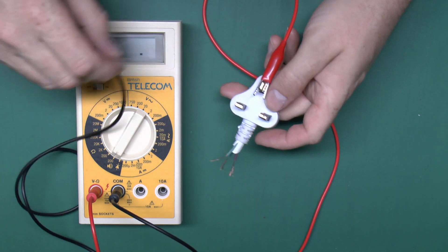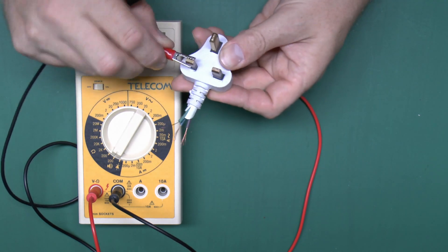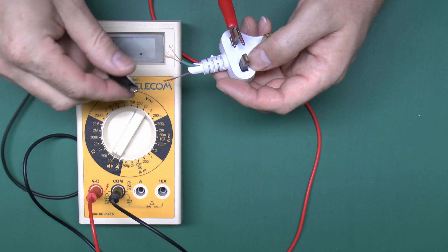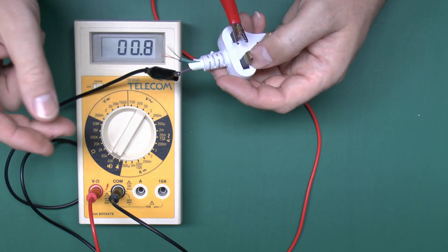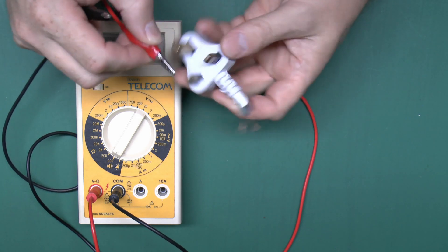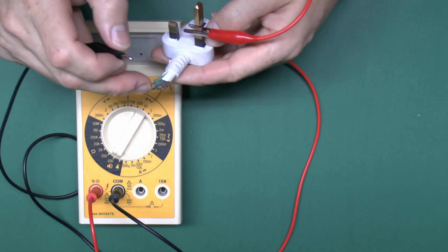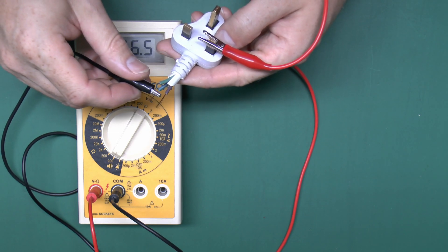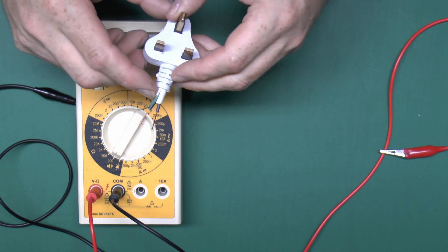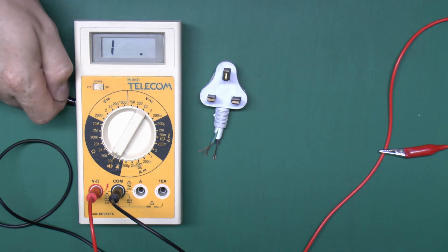While I've got this meter out, I thought I'd just check the other wires to see if they're connected to the correct pins. This pin here is the line, marked L — yes, that is the correct side, so it should be connected to the brown wire, and it is. And of course it's not connected to the neutral. The other pin marked N should be connected to the neutral — and again that checks out. So the other pins are connected to the correct colour wires, which is something. But obviously this earth is totally unconnected, so we'll have to open it up and see what's inside.